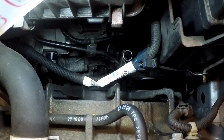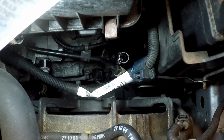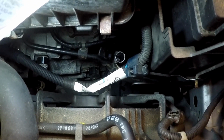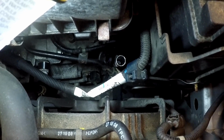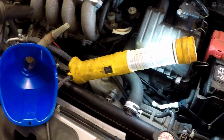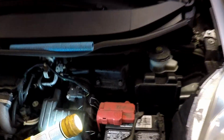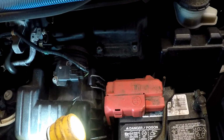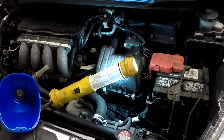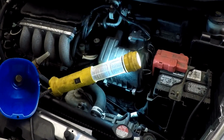All right, so I had mentioned that you refill the transmission fluid back through the dipstick hole for the gearbox. If you can look way down there, that's the hole for filling the gearbox. So it's not a little skinny oil tube like you are used to seeing maybe on your engine oil. So this isn't bad at all. My funnel's not long enough, but I got a little extension here, so I'll go down with that and then put the funnel in there. Sorry about me snuffing my nose. 2.6 quarts is what the manual says for a replacement when you're just doing a drain and refill. It's a lot more than that if you flush the whole thing, but I didn't do that, and I don't want to do that. So I'll put a couple quarts in and then start it up probably and start checking fluids from there.